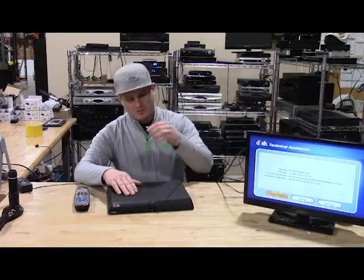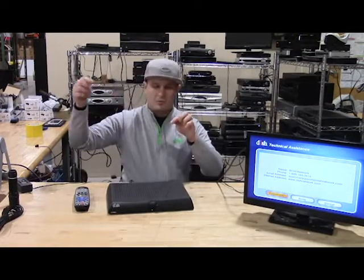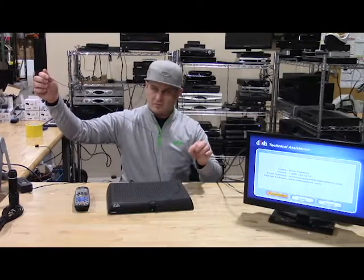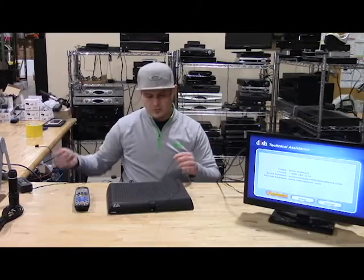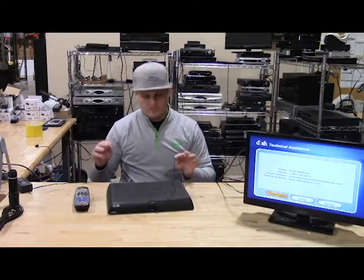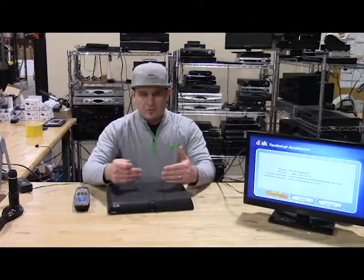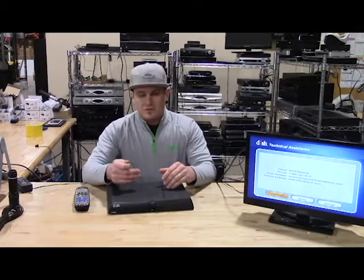Take your spare emitter heads, make sure they're tucked off to the side. You can pull the emitter heads apart like this to allow you to do that, but do not cut off your loose emitter heads. That'll cause the whole kit to stop working. So temporarily cover your device with a thick blanket and try controlling the device again through the repeater kit. If you now get better performance, that means you have a double IR signal issue.